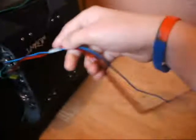You also need a loop cable, which is from a 12 volt battery, which loops over to the REM part of the amplifier. What that does is power the amp from the car battery. So you just get a small little wire and clip it round onto both of those. Now it's the next step, and it's actually powering the subwoofer from the cables. What you need is these blue and red cables. You get one that connects to the ground port, G and D, the top one, and you need the red one to connect to the 12 volt port on the amplifier. Keep them together neat and tidy.